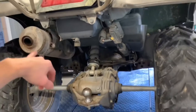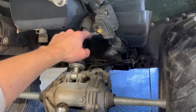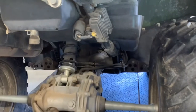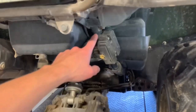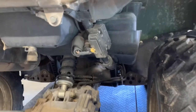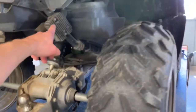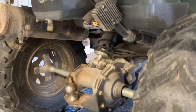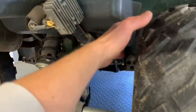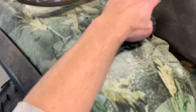Back here you've got a taillight and brake light system. Beside that is your regulator rectifier — this is a common problem on any ATV or motorcycle. When these go bad, your battery isn't getting enough voltage from your stator and will drain over time. It can also cause your battery to receive too much power, which could cause it to overheat — a dangerous situation. On this model, your fuel tank is under the right rear of the machine. Make sure there's no debris back there to puncture the tank. Your fill cap is right above that fuel tank.